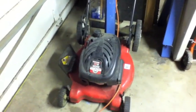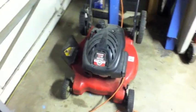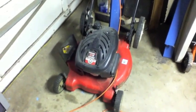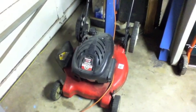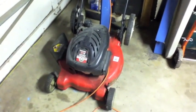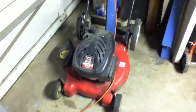I didn't want to take a quarter inch off the entire blade — I'd have to take it off both sides to keep it balanced, and it just wasn't worth the hassle. It's slightly heavy on one side, but I did the best I could without a fancy balancing tool, just using a screw stuck in the end of a sawhorse and letting it spin. We'll see how it does — if I notice any vibration while mowing, I'll pull it off and do a little more grinding.